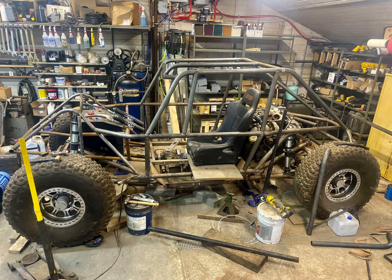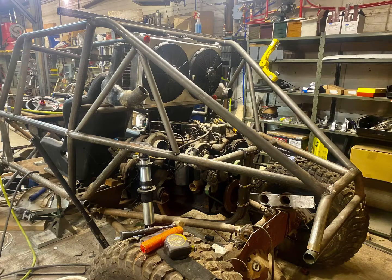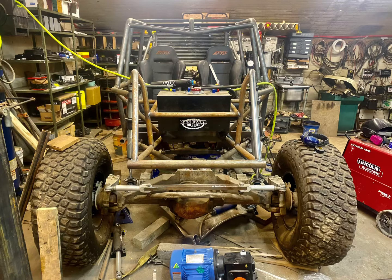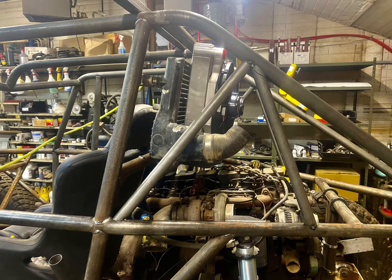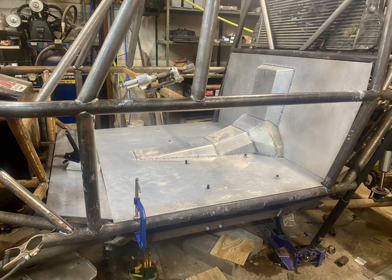While I watched the chassis come together I'll tell you a little bit about the build. This is an Ultra 4 off-road race car with a mid-engine twin-charged Cummins diesel engine. The transmission is a 47RH — all of the internals have been upgraded. It has a larger output shaft and a manual valve body. The axles are GM 14 bolts, which are mounted upside down so that they spin into correct rotation with a backwards-mounted engine.